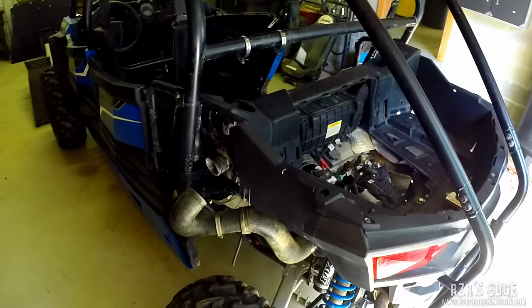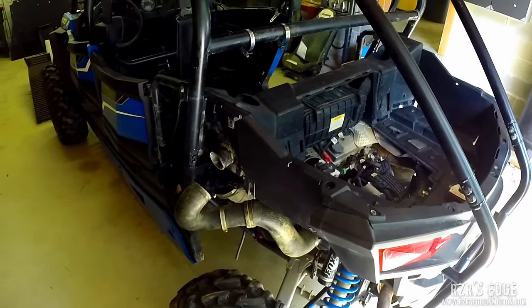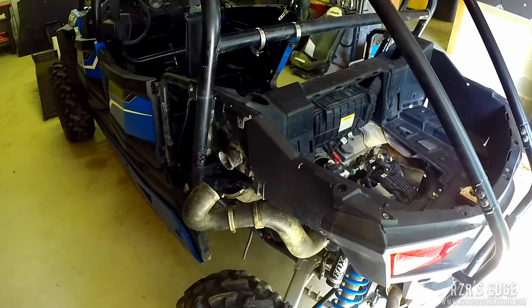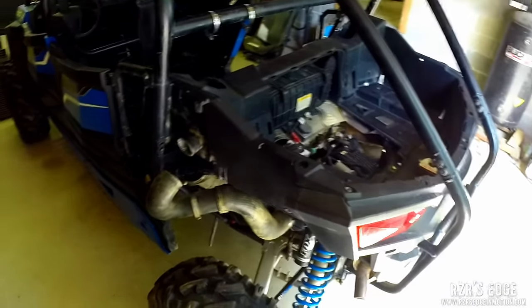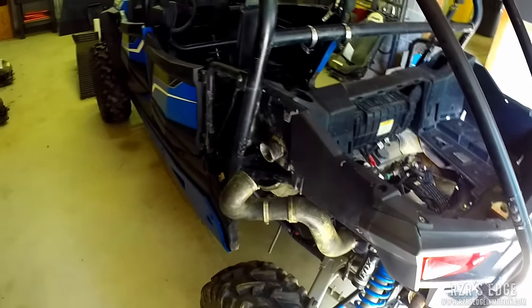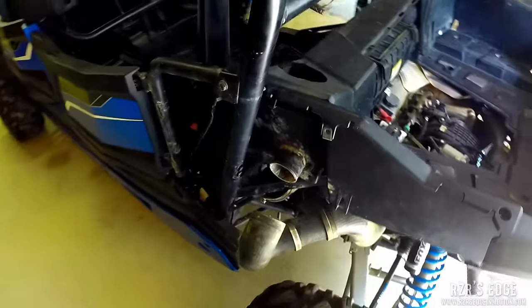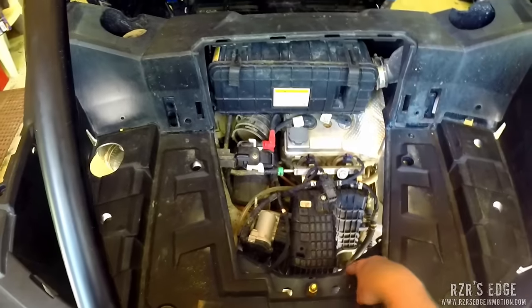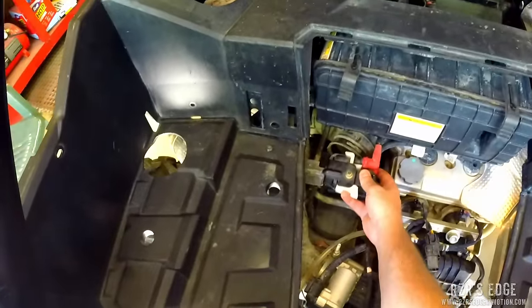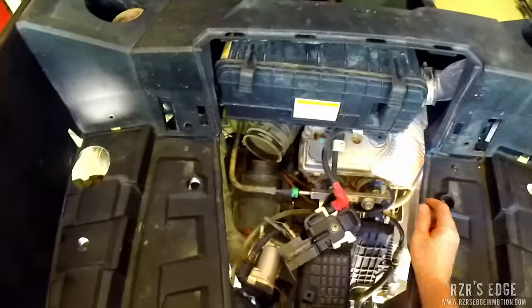Let's go through the preparation work. I can't show you every single step because I kind of had to make this up as I went along — I couldn't find any designs online or kits being sold that matched what I wanted. The first thing is to go ahead and remove the fenders. It just makes getting all this stuff much easier. They're not that difficult — just a few screws and speed clips. If you have the secondary belt intake on your machine, you'll want to remove the clamps and take that loose. The next thing is to remove the access hatch. Here's your coil pack — just temporarily remove it from the little side rail. There are two bolts that hold it in. Just take those two bolts out and set it off to the side. Don't disconnect it, just leave it like that.